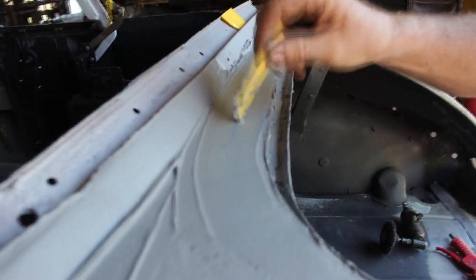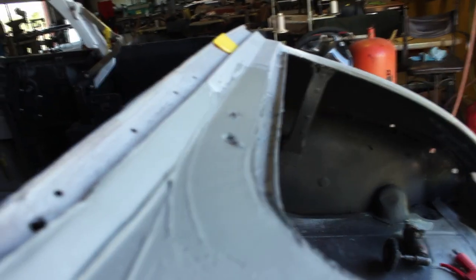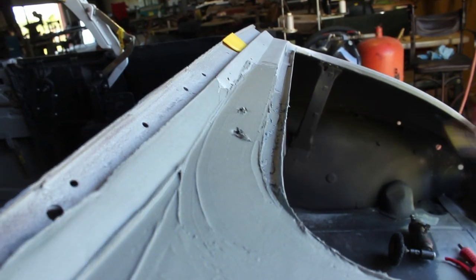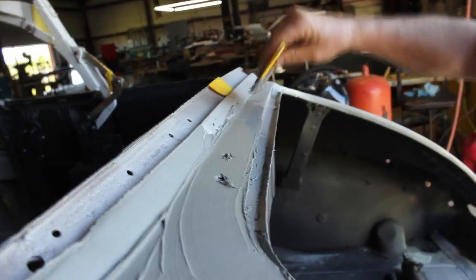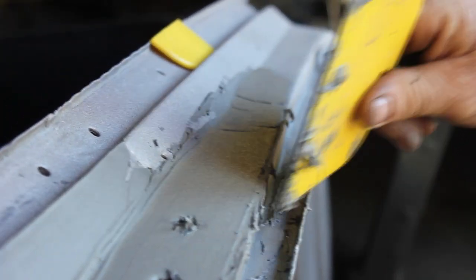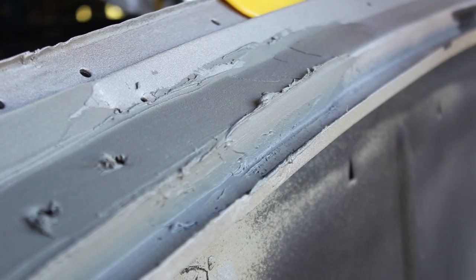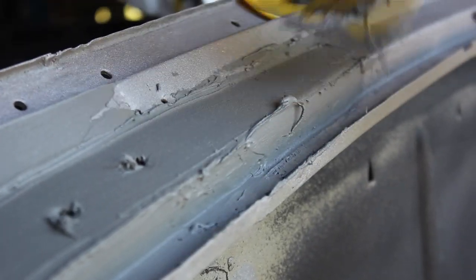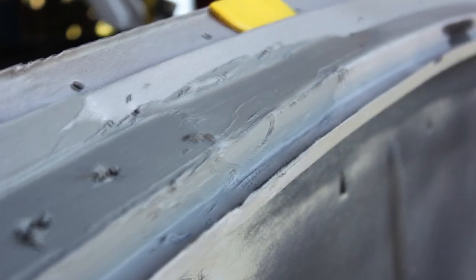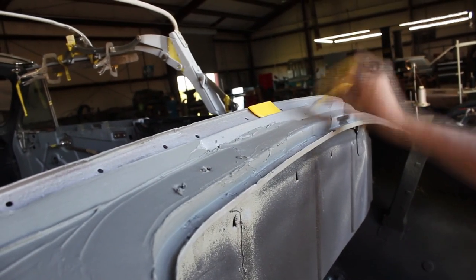As a binder, I'm using this over lead. A lot of times I do lead in all this. It's a real high grade binder. It's like a replacement for the process of using lead, and more people here would be able to use it. It kind of equals out to the same price as using lead in some formats, because it's five, six hundred dollars a quart compared to your regular body putty that you buy at sixty, eighty dollars a gallon.